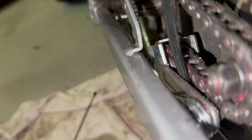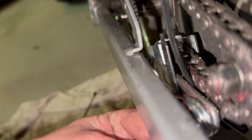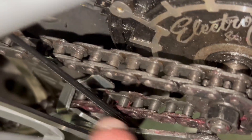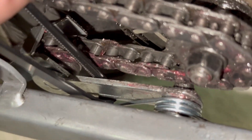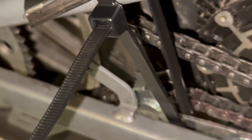I'll go down over the swingarm bar, under here, go down, and come back up. When I come up, I'm going through the chain tensioner and that spring, and coming through that zip tie. Now that we've got the spring holding that zip tie, it keeps it away from the bearings and the chain tensioner. It's pretty close — see how close it is. What we do is squeeze it away, and if you put this little nub at a certain spot, you can squeeze it at a different spot.